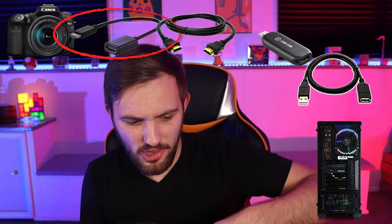So if you suspect it could be the cables, try swapping them out with other HDMI cables you have, maybe test it with something else, see if it works, because you could have a very old HDMI cable, or the cable could just be bad in general. Also, just try and limit the amount of HDMI cables you have going around in general. I got a longer mini HDMI to HDMI, so I cut out one of the cables in the process.